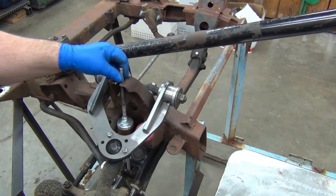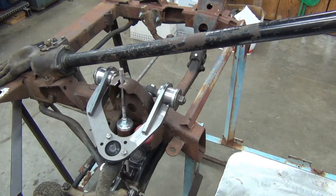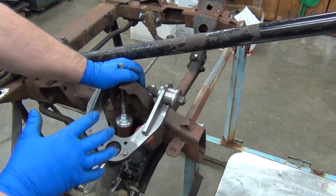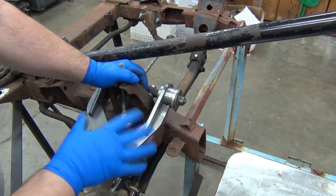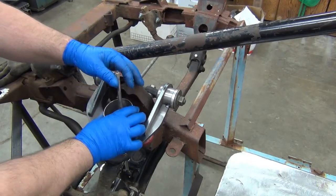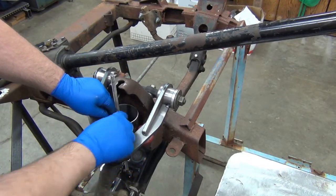Well, I've been asked about checking whether or not a coilover would fit in here. So the coilover is basically two different sizes, either 2-inch inside, 2.5 exterior, 3.5 exterior, something like that. OD is all I'm concerned with. This is a piece of driveline that's 3 inches, and you can already tell that it won't fit between the bump stop brackets.